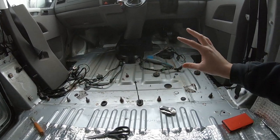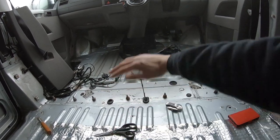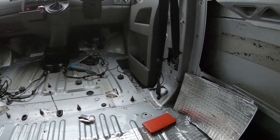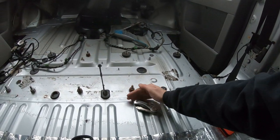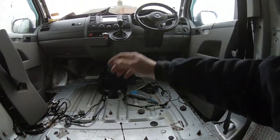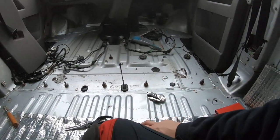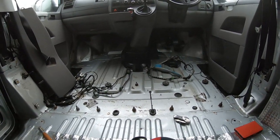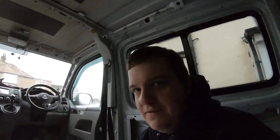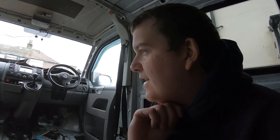I'm going to cut strips across the back here, then put strips in the middle between all the seat base bolts, and go from the other side of the bolts too. I don't really want to put extra material where the seat base actually sits, so I'll go inside the seat base and just behind and just in front of it to avoid any fitting issues — it's only two mil but you never know. There'll just be a small slither in the middle with nothing, but at 70% coverage you get near enough the best results and I'm going for well over 70.